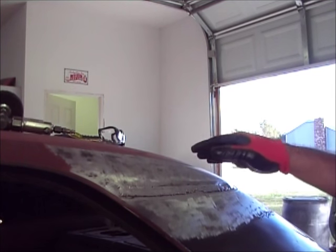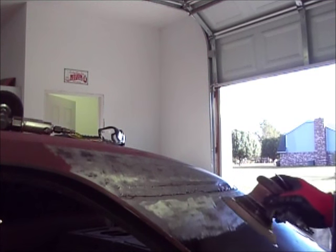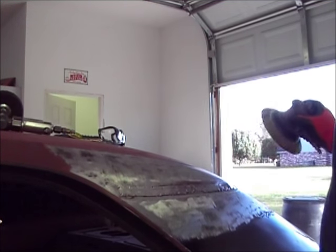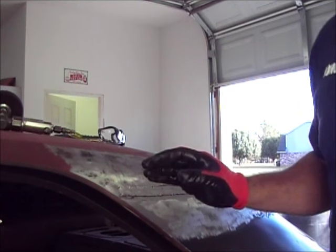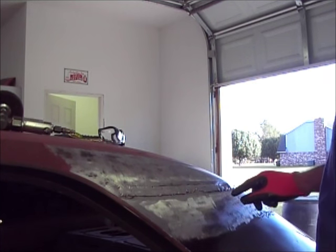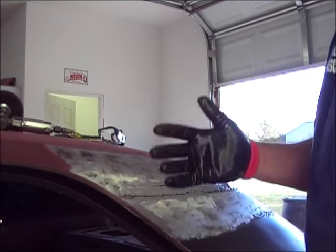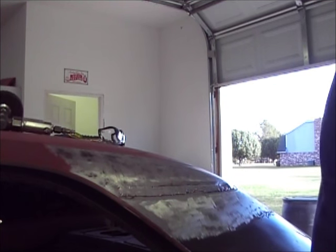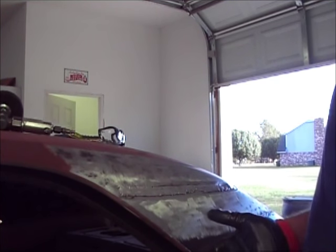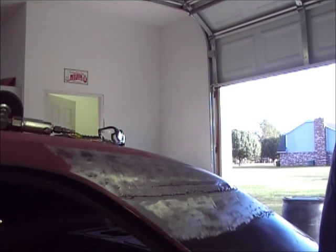So now what I'll do is I'm going to clean the metal real good with 180. I'm going to get all this cleaned up real good with 180, and then I'm going to go back over it with 80 real good. That's going to sound like overkill. Then I'm going to dress it with a brand new roll lock with 50 grit down to where I'm going to do, and then let it blend out into the 80 grit basically. And then I'm going to clean it really good with wax and grease remover again, and then I'll start the tinning process and start putting my stuff on there. So that's kind of my plan. That's what I've seen other guys doing when they do it. And hopefully this is the way to go as far as getting it cleaned up. All right, guys, I'll bring you back in a minute.